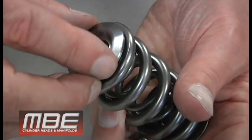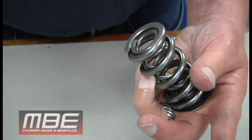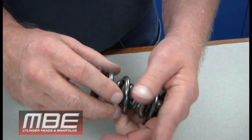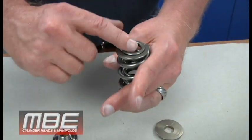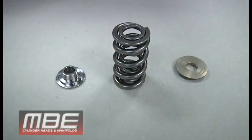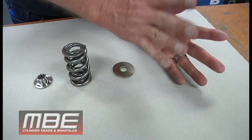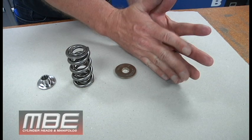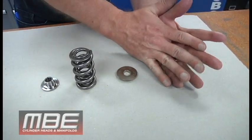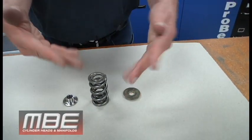The retainer fits on this lip and on the inside here — it doesn't have to be super tight, but it can't be loose. The reason is we want to keep the center spring centered with the outer spring as much as possible, because it's all about friction. If you think of the inner spring and the outer spring: if they're centered they move like this with much less friction. If not centered, they go in and out — that's more friction.